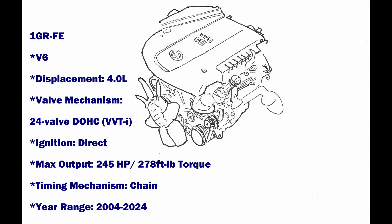ORS only offers the engine format for the 1GR-FE V6 engine. In most cases it is simplest to use the transmission from the donor vehicle. Some donor applications are equipped with an immobilizer and will require ECU programming or additional wiring circuits to accommodate. If using an auto trans donor ECU with a manual trans swap, the ECU can be programmed to eliminate associated diagnostic trouble codes.